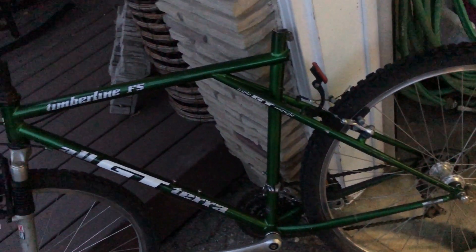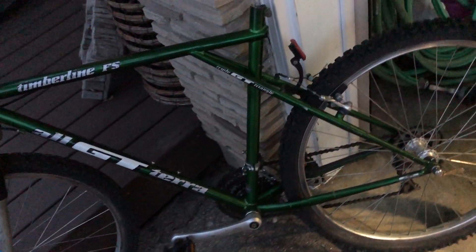Eventually I ended up cutting the seat post off, and then I had read about gallium. I bought some gallium online — what it does is it reacts with the aluminum and makes it brittle. I got some gallium, did that, and got a good chunk of the seat post out.